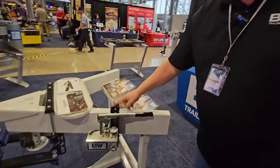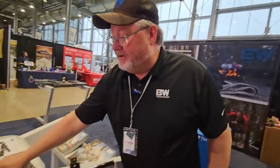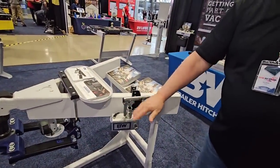That's what's a bonus on this — you have a basic 30-minute setup. Realistically, because every bolt and nut is one size wrench, it's all the same. You'll measure it, put it where it needs to be, same with this bracket, and everything else is pretty simple. So it's just like shake, plug and play — you adjust your height on it and then your ram, which is in the neutral position, which is going to be the majority of your vehicles. It just depends on how much droop you actually have.